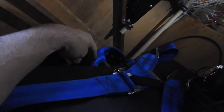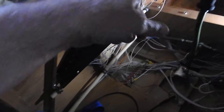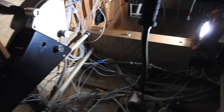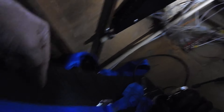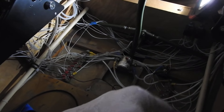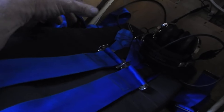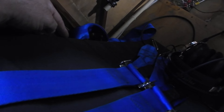I also took out the solenoids for the hydraulics that are behind the seat, because they were all wired differently and weren't going to work with this to trigger these LEDs. So I pulled them out, and all I have to do is run one side of the coil to the power lead coming off the relay for one side of the motor, and the other side of the relay power lead to the other. They're both at ground when sitting like this. I'll run one solenoid wire to one side of the motor, the other solenoid to the other side, so when the motor kicks on the solenoid will get energized. The other two wires off the solenoid will come in here and ground. Pretty simple.